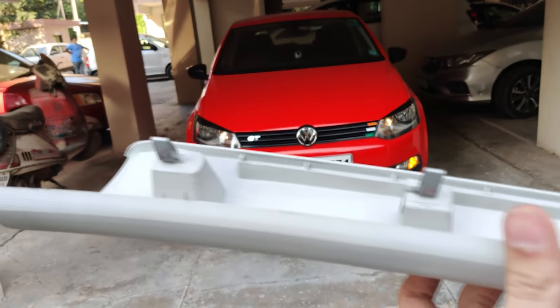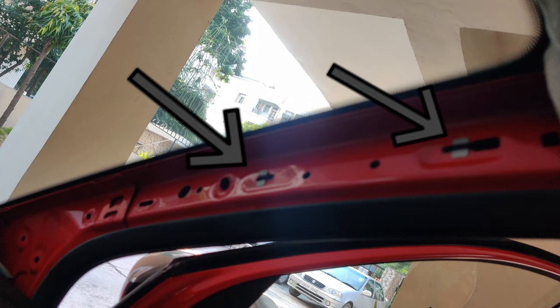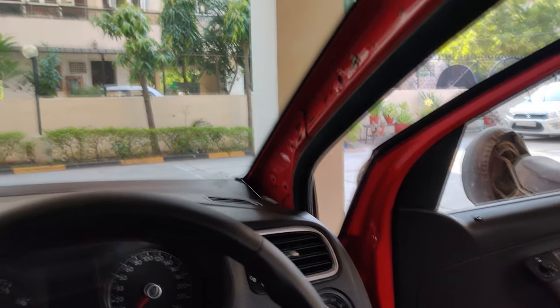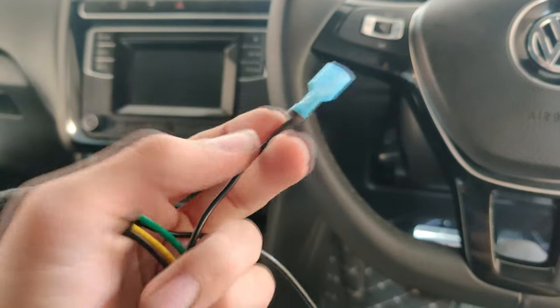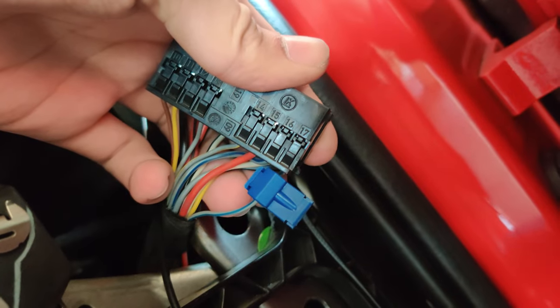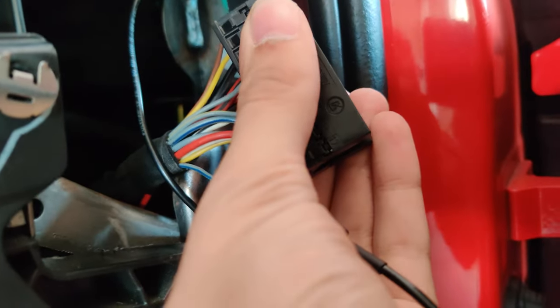The A pillar trim has three locks in it. If you pull the trim out correctly, you won't see these metal clips left on the body of the car — instead, they will be on the trim piece. After successfully removing it, you can route the wire with its cable connector through the headliner. To get to the A pillar from the cabin light cavity, I ran a metal wire through the headliner, tied the cable connector on one end, and pulled it through. After routing it through the A pillar, I tapped it into the 17th terminal of the headlight switch connector and plugged it into the cabin light connector as well.